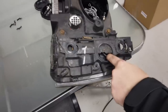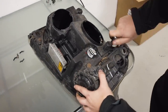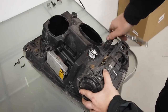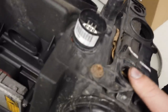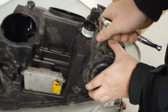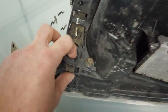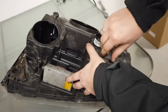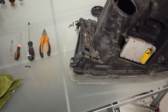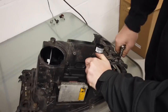I took these brackets off because you need to get to the indicator — this was tricky. Taking the bracket off — Dan did come to me at one point when he got stuck. What size are the bolts? Ten mil. You've got to take both brackets off. There's one here and one on the other side. They hold the slider. There are four bolts on that one. All those bolts are the same length — they're a coarse thread.